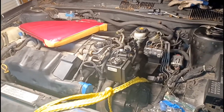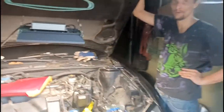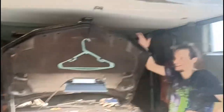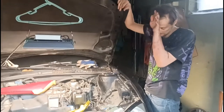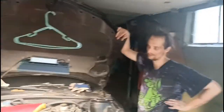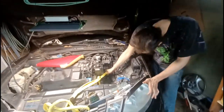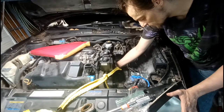Oh yeah — while you have it out, always do everything you can so you don't have to deal with trying to torque it back on later. I couldn't even find the torque specs. Yeah, that's hard — someone was talking about this car and then it'd switch to another car. People were saying 25-30 foot-pounds would be good for the pressure plate, and like 30 for the transmission, probably about 25-30 for the bell housing. At least it's in there.